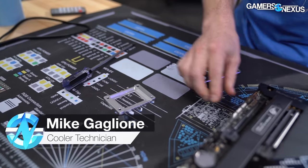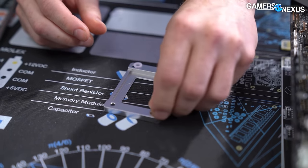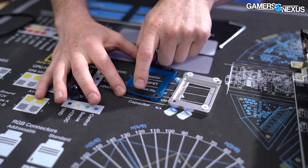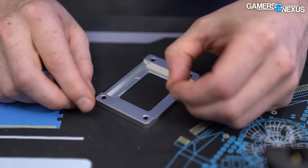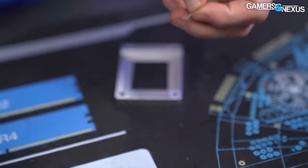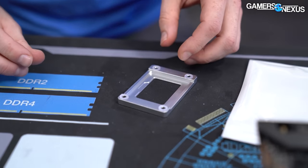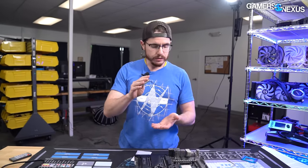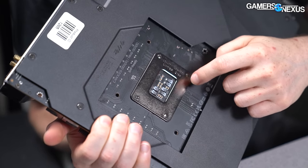The Walmart frame comes with washers that you have to adhere on yourself. They have an adhesive backing, so once you get them in place they will stay. As opposed to the Thermal Right, where this non-conductive surface comes pre-installed, you have to put these on yourself. I just lined them up by eye and they were pretty easy to get correct. We recommend installing whatever cooler backplate you're using onto the motherboard first, so it holds the ILM backplate in place and you don't have to grow a third hand.